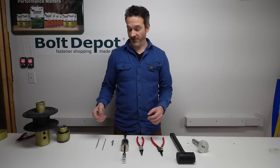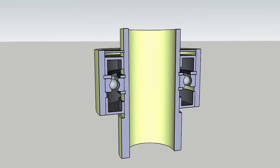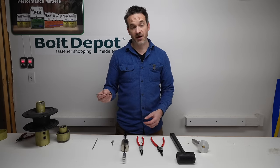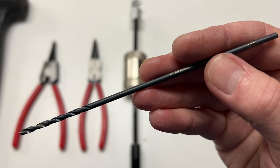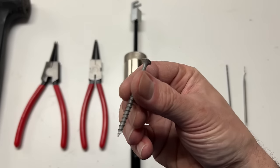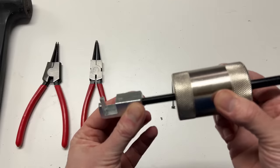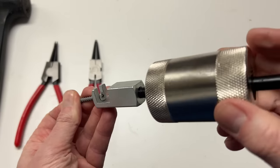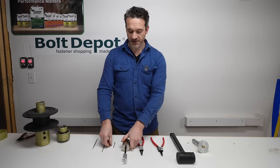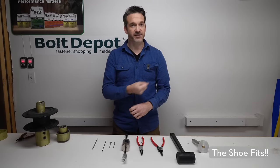Let's take a second to talk about the tools you'll want to perform this work. First, you'll want a little pick — some sort of very small tool to get in and underneath that cover on the upper swivel to expose the seal you're going to pull out. The best way to pull out these seals is to drill two holes in the steel cover that goes over the lip seal. You'll want to get a long drill bit — that's going to be helpful when you're working on the lower drum unit because it's such a deep recess. Then I've got two generic screws that go into the oil seal, and we're going to pull them out. The best way to do that is to use a slide hammer with a fork end to get your screw in there and pull using the impulse of the hammer. I've seen a lot of these get damaged by people trying to drive in screwdrivers and pry the seals out — yes, you'll get that seal out, but you'll have a bunch of damage to your part.